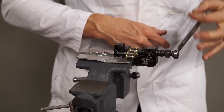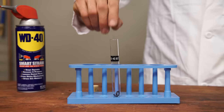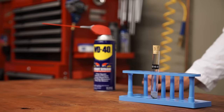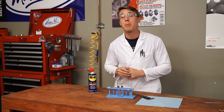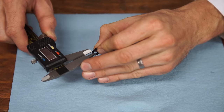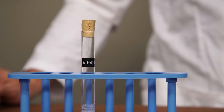To find out just how detrimental WD-40 might be, we disassembled the chain, dropped some o-rings into a test tube, filled it with WD-40, and let it sit overnight. And the next day? They were fine. Compared to the control o-ring that slept in an empty test tube, the parts in the WD-40 bath were the exact same size and consistency — and this is after 12 hours of total submersion.